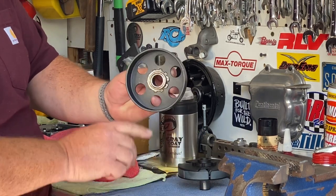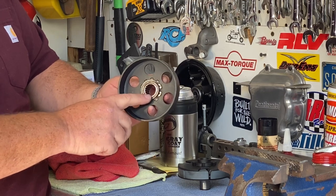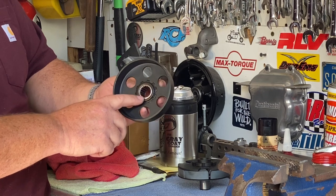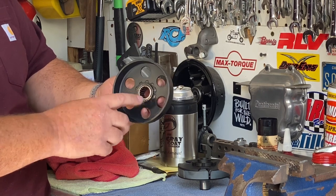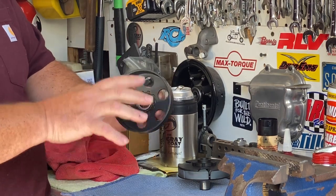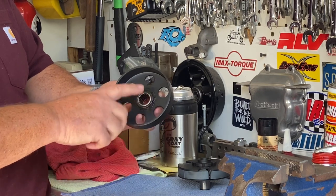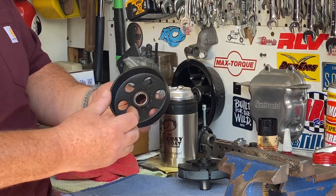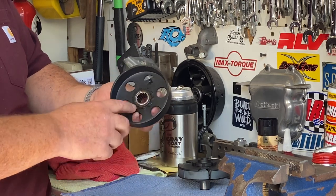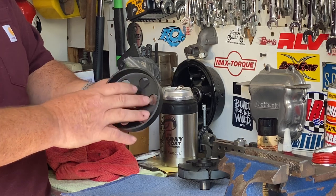The clutch has needle bearings on the inside. Just like every bearing from China, there's never enough grease in there. If your clutch is old and crusty and you can see the grease is nasty, use some carburetor cleaner. I do not recommend carburetor cleaner or brake cleaner for standard clutches that have a bronze bushing — you'll dry out the bronze and you'll kill it. But for needle bearings, we can clean it out with carb spray by spraying it in here and moving it around until all the old grease is out.